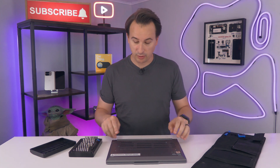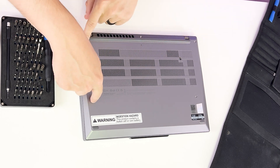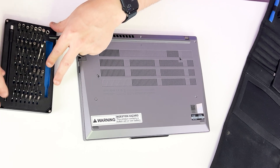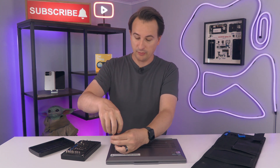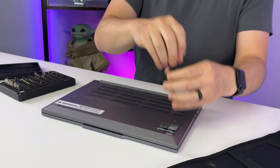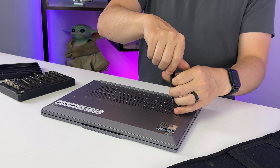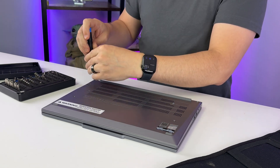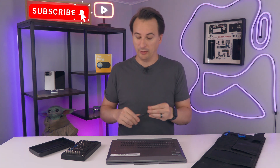Taking it apart starts with these well-marked screws. What I love about these screws is: A, they're Phillips screws — no special hardware needed. But B, they're what's called captive screws, meaning they won't actually come out of the case, so you won't lose them. These two are marked as keyboard-specific screws, for when you want to replace the keyboard, which is possible. As someone who's done this before, that was one of the most aggravating parts — you so often ended up breaking the keyboard trying to get it out.